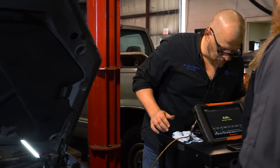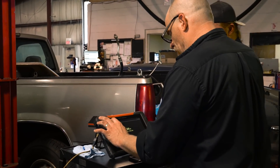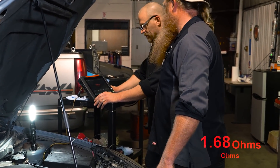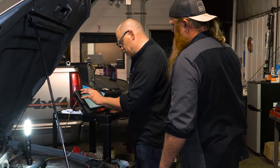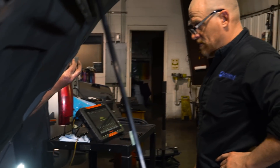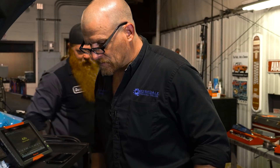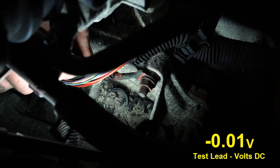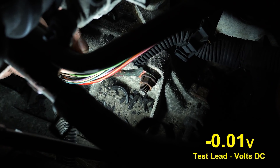I was checking resistance first. You want to go resistance to ground on that. It's going to read zero with it starting right now. I have 1.8 ohms in that location — I'd rather see the volt meter. Or we just wiggle the wiring and show what you did. I should be able to see a voltage jump when you wiggle that. You're grabbing where it's crimped to that connector, not where it's actually messed up — it's right underneath the throttle body, at the transmission stud.